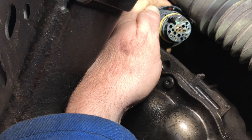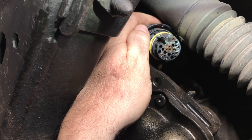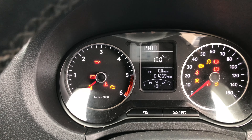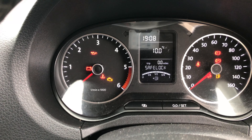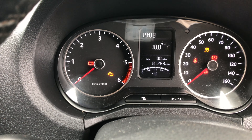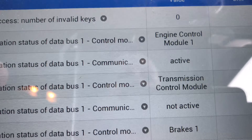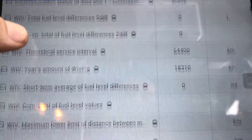What I'm going to do is spray it with that electrical cleaner - let's see if I can clean this up and get it going. So that's a big multi plug going into this - this is an 8-speed ZF box. So I took that multi plug, sprayed it with that stuff and put it back together. And we'll have a result - it no longer starts now. So when I crank it, it says park neutral, then comes up with brake, safe lock, park neutral. Well it won't even crank anymore. You can see that I'm into the dashboard module number 17 - it's got the engine control module, it can communicate with that. Active: transmission not active, brakes active, central electric active. So everything else is fine. So it will not allow the thing to start.